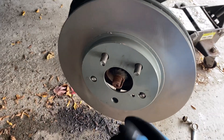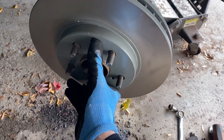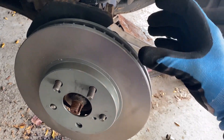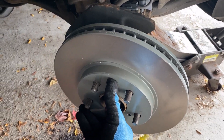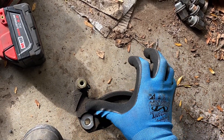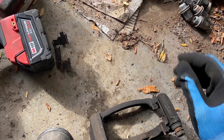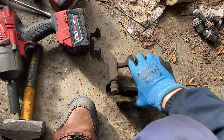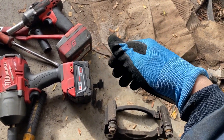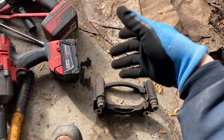It's going to be the wheel that holds the rotor flat, so don't worry if you have it moving around. Once we get the caliper bracket and caliper on, that'll hold it more straight as well. Now we're going to divert our attention to the caliper bracket and go ahead and take these clips out — should be able to pull them out by hand, otherwise use a screwdriver to pry them out. Before you rip the old ones out, make sure your new pads come with new clips because some really cheap kits do not include them and you'll have to reuse the old ones.